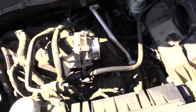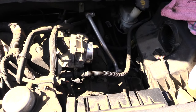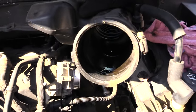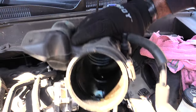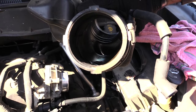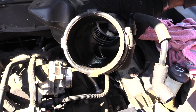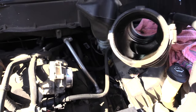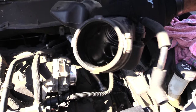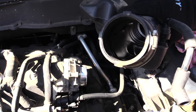Basically, this is what you want to do if your vehicle's service traction control light is coming on and your vehicle has reduced power — most likely your throttle body is dirty. Take some throttle body cleaner and clean that out. Also clean inside the air pipe as well. Please check out our other helpful videos, and please like, subscribe, and share. Thanks.